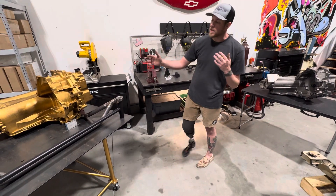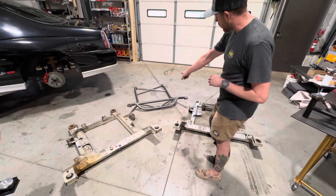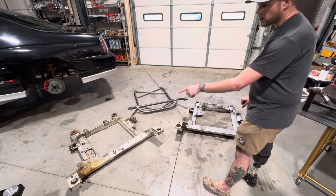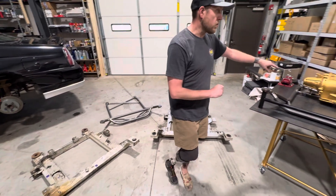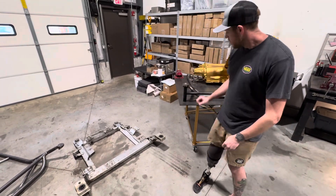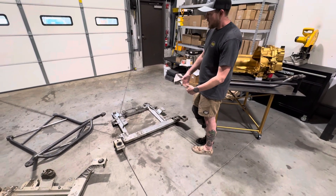Some of the other highlights and benefits: take a look at them on the ground. On the final design, our gussets and that crossbar are gone. We support it differently, but it opens up the footprint for serviceability of your drivetrain significantly. The 3800 V6 subframe with no mounts on it tips the scales at 46 pounds. Modeling shows this unit with all the bracketry on it coming in at 35 pounds. Right off the rip you're saving 10 pounds just from structure to structure. And when you get this, it already has solid cups — you don't need to buy subframe bushings. You save money there, money you'd otherwise be investing into what is now approaching in excess of 20 years old.